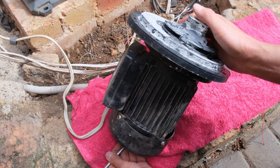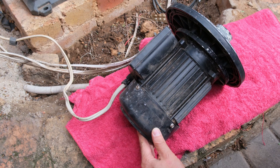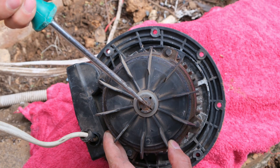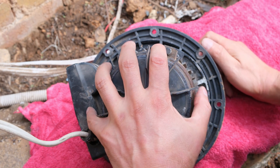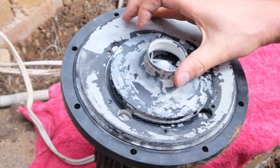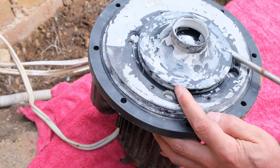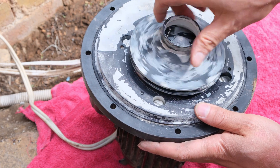I have a screwdriver in the back and I'm holding it firm, but I'm still unable to get the impeller off. Another way is to remove the back cover to get a better grip — just using a star screwdriver to remove the four screws. With the cover open I can hold the back with my hand, and on the impeller side I can just turn it. It's actually coming loose — it wasn't that tight. Note that this is unscrewing anti-clockwise.